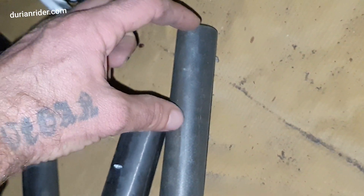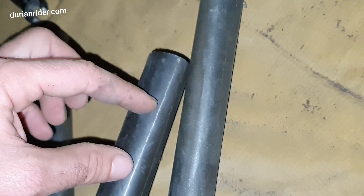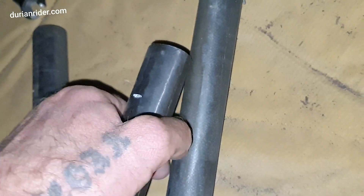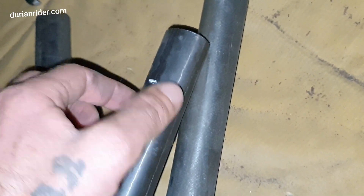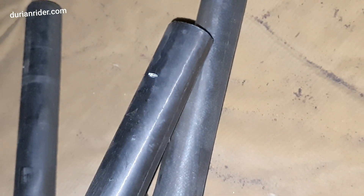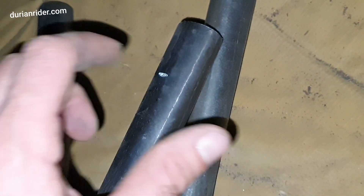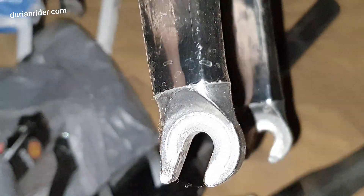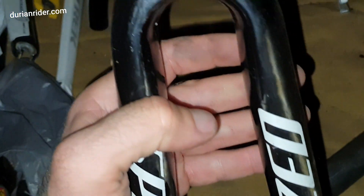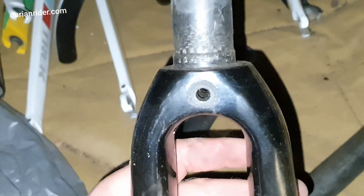That's how carbon forks can break. Mostly it's because people don't have a long enough plug and they have their stem down too low, so the stem bolts crush the steerer because the plug doesn't go deep enough. Another cause is the ring of death — the marking from a loose headset. And then the other one is just the fork tips as well — fork tips out of a crash can have some cracks in there. It's just good to have a look around. Crashes do happen from failed parts — I've seen it a lot.